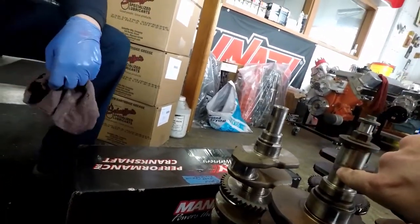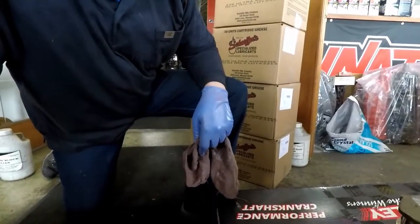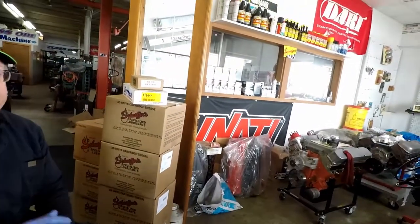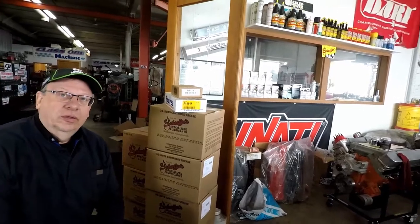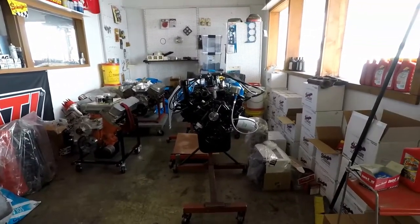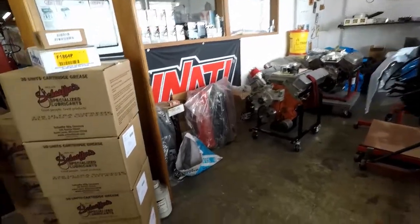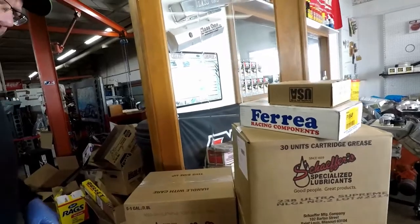You like that? So then on the cranks, I hopefully didn't wear out, but I marked what I got. Yeah, like that one's 2,000. And then I rechecked this one, and that one's 1,000. And then Toyota spec is 2,400s, whatever. But that's their Toyota factory spec. But anyway, we need 5 total. So we got 6 here. So you can not do one of them, but I brought an extra just in case it's a crack.